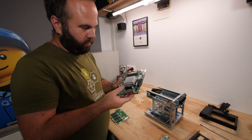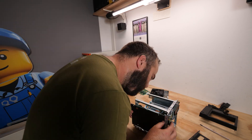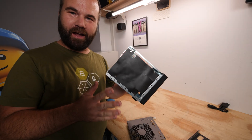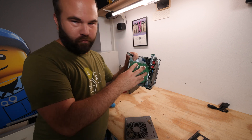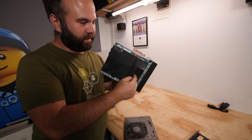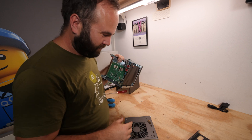There's a chip here that looks like a memory chip - maybe they stored Linux directly on it, not sure. I found the proper disassembly order: remove the back with the fan, remove the SATA backplane, remove the SSD expansion, and then slide out the motherboard to change the memory. You don't have to remove the front panel at all - it was easier than I was making it.